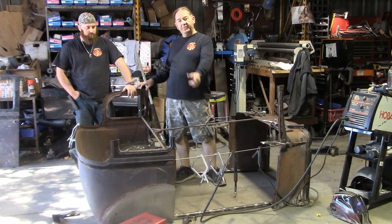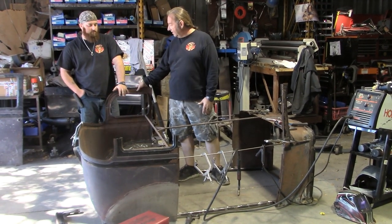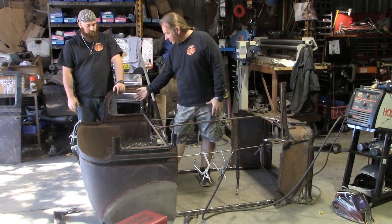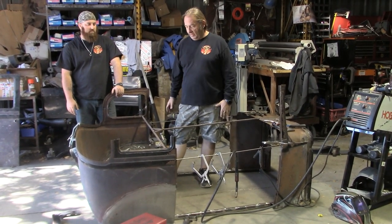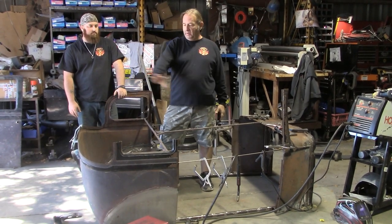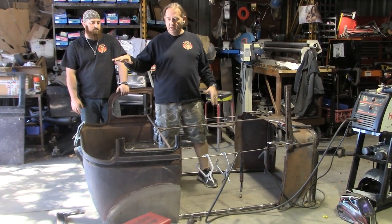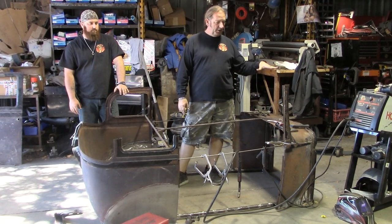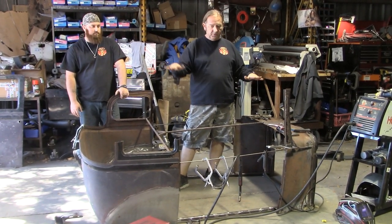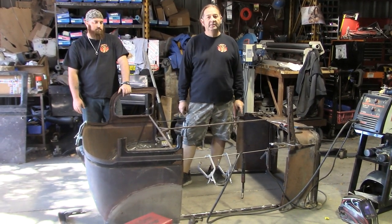This is the original A-pillar height. We've already cut the back windows — they were 14 inches tall; we took five inches out of them so now they're nine inches. This nine inches is the same as the back window, so the side window and the back window will be the same height. It'll give it a more natural look instead of that mail-slot look you see on a lot of chop tops. The doors will also be nine inches. When we put the roof back on we're going to do a five-inch chop in front and a six or seven-inch tilted chop at the rear — it'll pancake the top a little and bring it down.